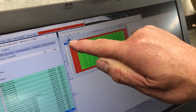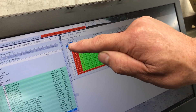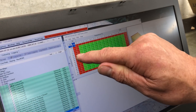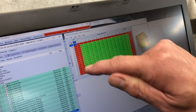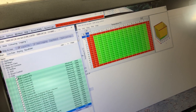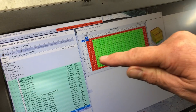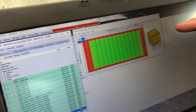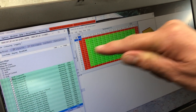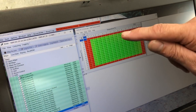Across the top of the scale you start at minus 20, go to zero, and right up to 80 degrees centigrade. Down here it also goes from minus 20 all the way up to 80. The red cells have an 8 in them, meaning the factory standard map says EGR is not to be turned on. The green cells - anywhere that is not 8 - is scaled, so effectively the EGR valve starts turning on. In the middle of the map is the typical operating conditions that Mitsubishi decided the EGR should work.